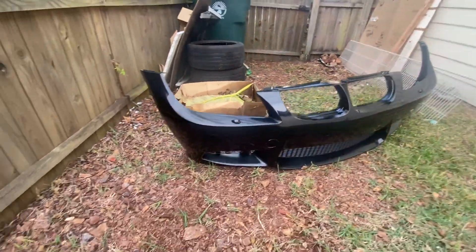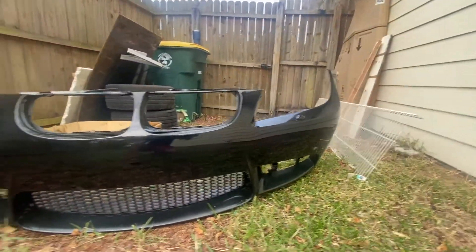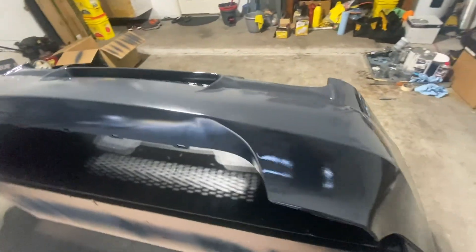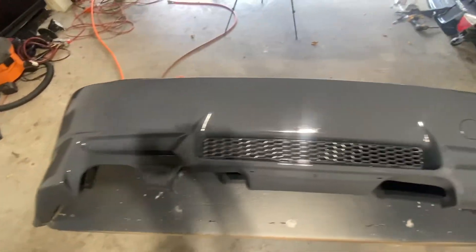This doesn't look bad at all. Also, this bumper is really aggressive — I'm thinking I want to spray that lower section gloss black, and I'm going to need to get some fog lights too. Alright, we've allowed the sealer to flash off — it's been about 30 minutes. Here's what it looks like after two coats of sealer. I have really good coverage everywhere so I'm pretty happy about that. I want to make sure I get enough base coat coverage because I was lacking some on the front bumper and didn't notice until after clear coat. Let's go ahead and spray the first coat of base.